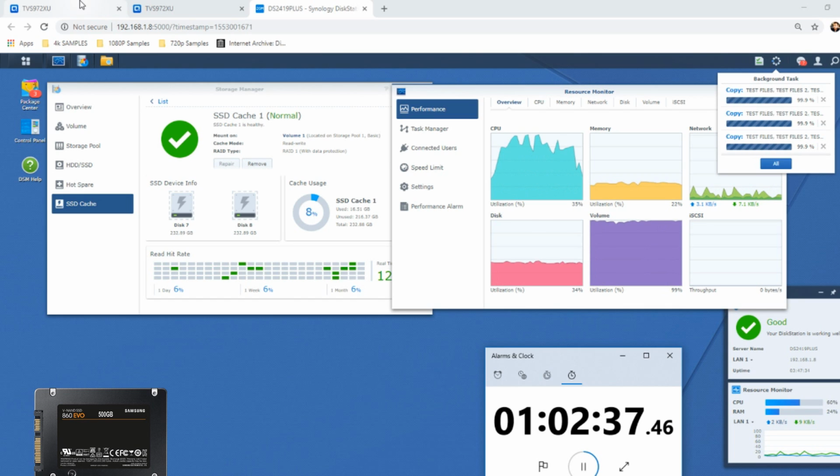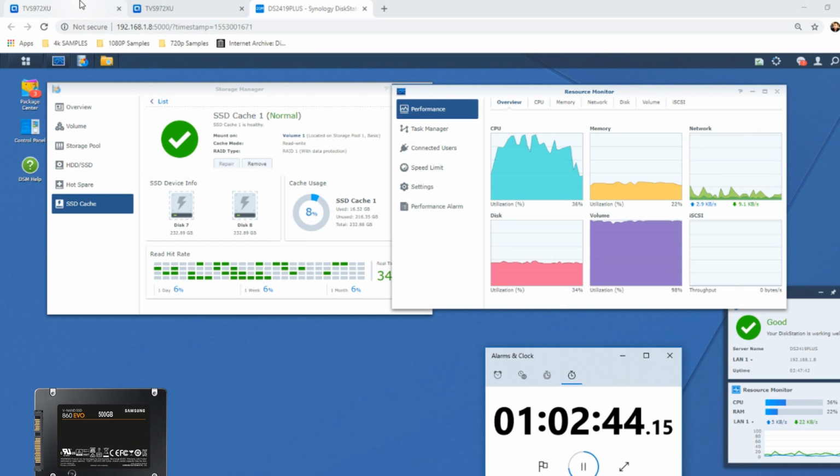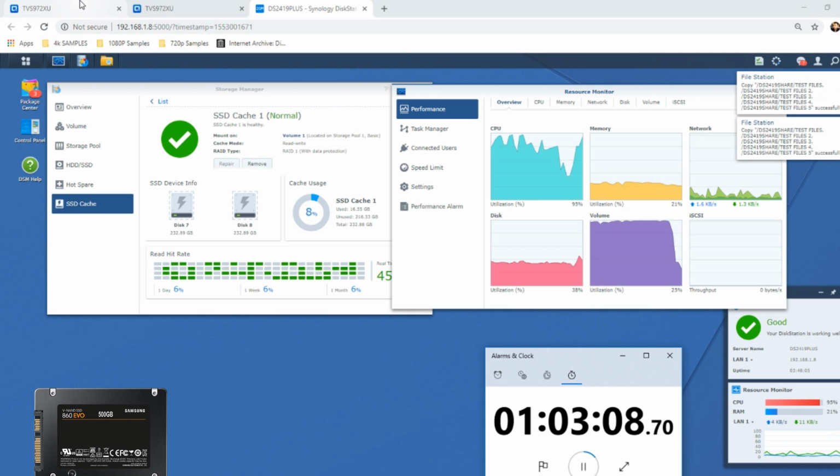And as it closes in, we've almost done with all 3 transfers onto that drive, but immediately look at that time difference. The previous test there took around 96 minutes and this has taken just over an hour, 62, almost 63 minutes for that copy across those 3. And of course that was largely assisted by that SSD cache. Once again, we knew that was going to happen, and we've done SSD caches before, but just take a moment there to think about the benefits of SSD caching even to a single hard drive, and that is something that only gets better once you introduce RAID.